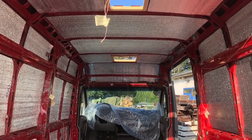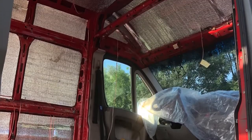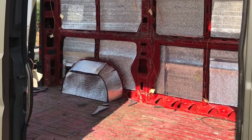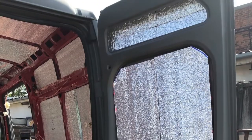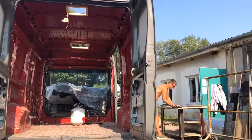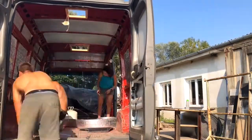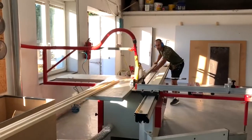Next is the insulation. There are many ways to insulate a camper van and this topic is broad — you should research it on your own. I chose silver double-layer 18mm and mirror foam. In this case it's important to cover everything with panels and leave some air gaps. I sprayed contact glue on both surfaces — the car and the insulation — and then just put it on like a sticker. My friend Richie helped me out: I measured, he cut shapes, and this entire phase took just a few hours.